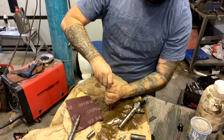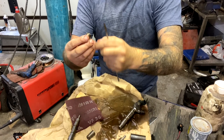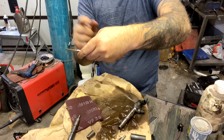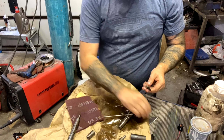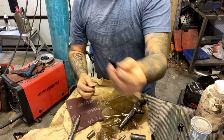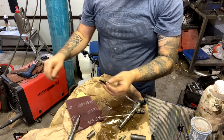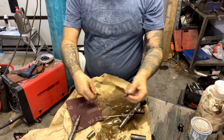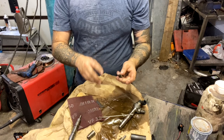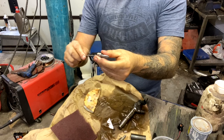That's not going to be doing any good, is it. There you go — and that's what that looks like. They do vary on different injectors but the principle is the same. Sometimes you just have a short injection nozzle, then a double packer in the middle, then a spring on the opposite side. To clean it, all it involves is first scraping all the carbon off. I soak everything and clean it in nothing but petrol — you can see all the carbon and crud coming off. Not going to waste your time on the full clean — just a bit of emery, bit of red Scotch-Brite, clean it up nicely, then build it back together. By the time I've cleaned all the tips and soaked everything, you can see it's literally clear.